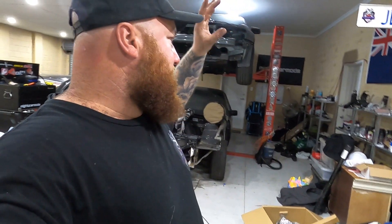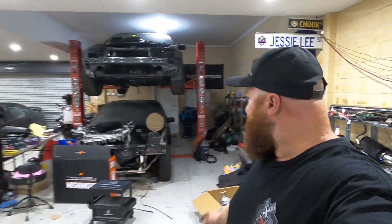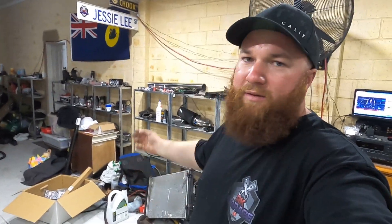It's got a T51R mod on the compressor housing, the front's been polished. It's a genuine Garrett core, genuine Garrett turbine cover, genuine Garrett compressor cover, but completely custom inside - which is really awesome. So in theory that should go 850. We'll see where it maxes out. If it makes 750, it makes 750; if it makes 800, it makes 800; if it makes 950, it makes 950. So that's that.